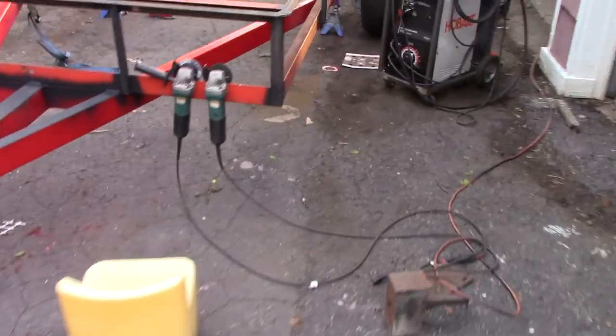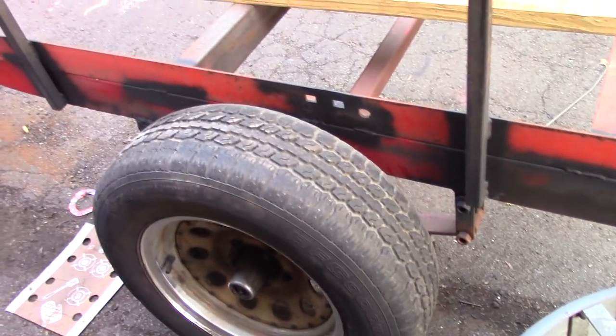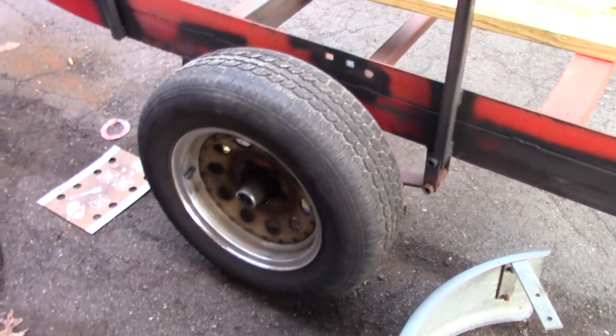The next challenge is going to be the fenders. They're a little bit challenging because I don't want to buy new ones and these are galvanized - the angle brackets on the galvanized sit off about an inch and a half off the frame. What I came up with: I'm going to take a piece of angle, cut four pieces - one for each bracket, two here and two for the other fender - drill two holes in each, put some bolts through the fender onto the angle, and then the angle just gets welded up on the frame. That way, if I ever need to remove the fender, I can just unbolt it.